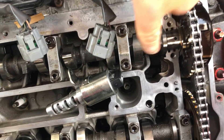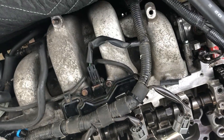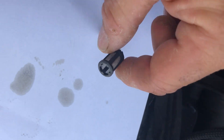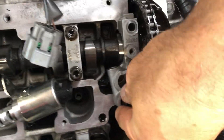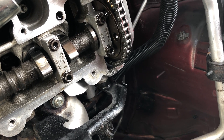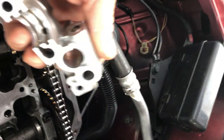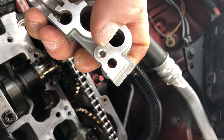The intake camshaft has an end cap which sits in here. The oil supply is right here, and there's a filter inside that goes in there. The filter must be absolutely clean for sufficient oil pressure to flow into the cap. The torque on these bolts is almost 90 inch pounds; this one is 70 inch pounds. You also have to make sure this surface is flat — I sand it with 600 grit sandpaper to make sure this oil hole is being properly fed.